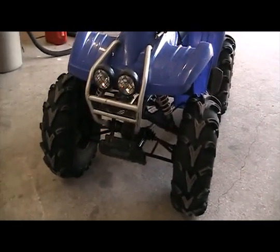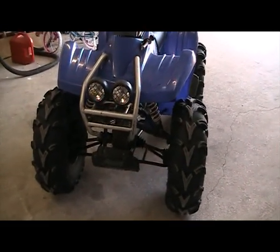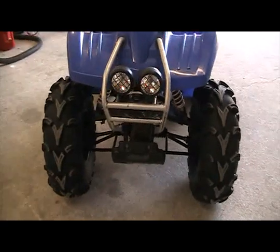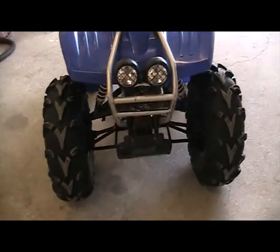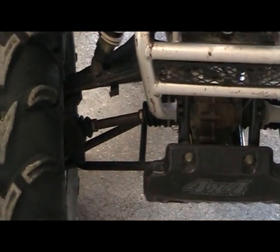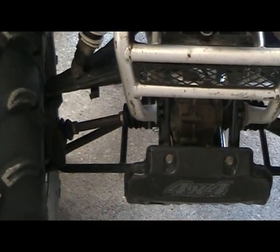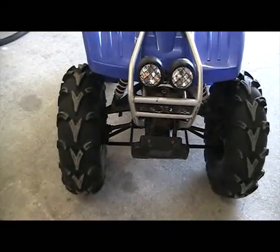Air intake has been modified and it runs very well. We've had this bike come in the shop a year ago — we did some small performance increases on it. Now they want to go for the big bore kit. Clean bike, good looking bike. We've got an axle here that's broke — the shaft is snapped off on the upper side next to the gearbox. We have a new shaft we're going to install to get the front wheel drive working again.